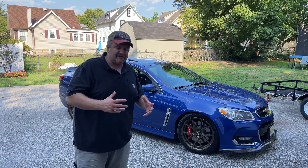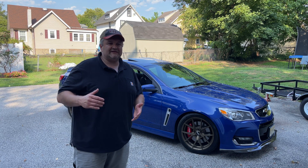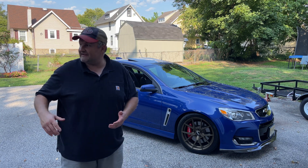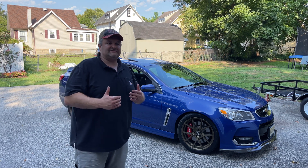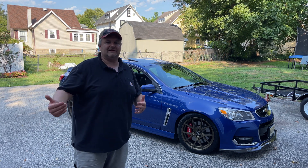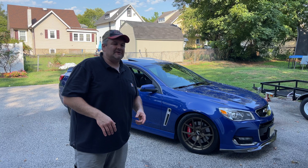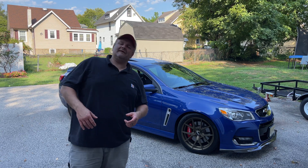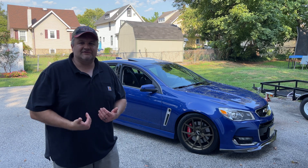So what I want to do is get you in the car — let's take a look. I'll show you what I'm talking about. We'll get on HP Tuners and I'll show you what I'm looking at. One of the things you really need to do before you go get your vehicle inspected is ensure that those monitors are complete, or at least know what your particular state allows. In my case, I had six monitors I had to look at, and I didn't check that — so that was dumb.